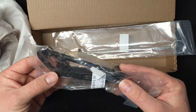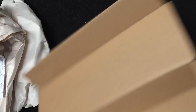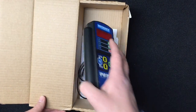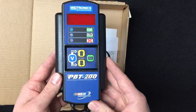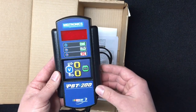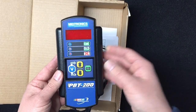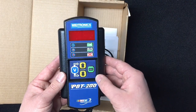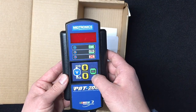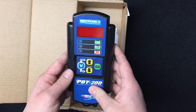That's definitely a need in any Ford shop, so I had to get one of these. Doing phasers with the front cover off, this will hold the phaser in place while you're working on it. Now this next tool I think I'm most excited about — it's a Midtronics handheld battery tester. These are basically the same design and core technology as the handhelds we used at the dealership for years. Those were so reliable they were used for warranty purposes and actually generated a warranty code for payment from Ford.